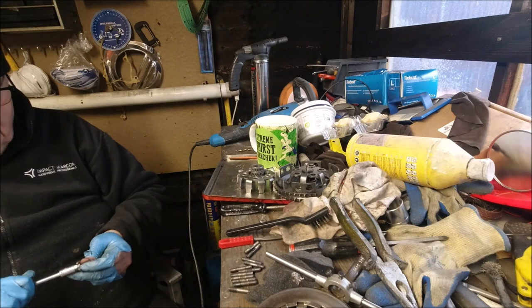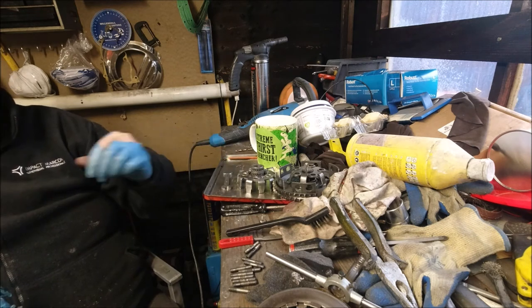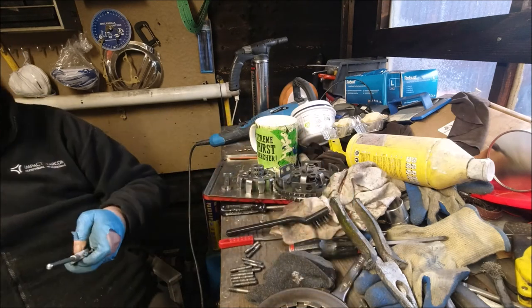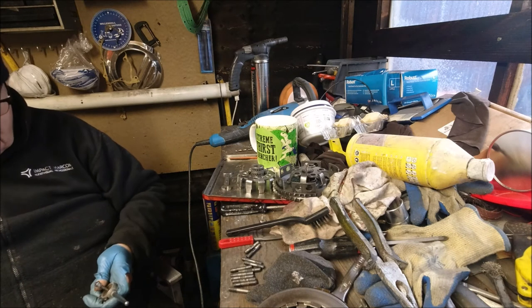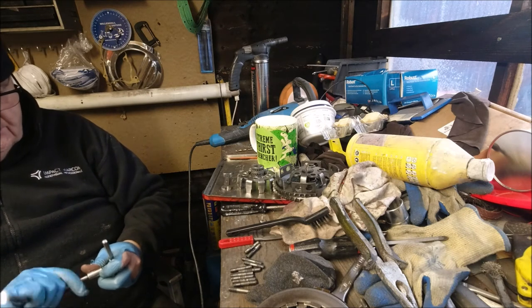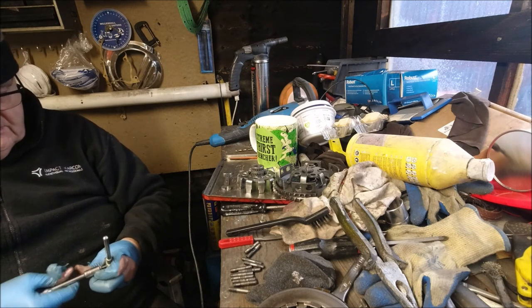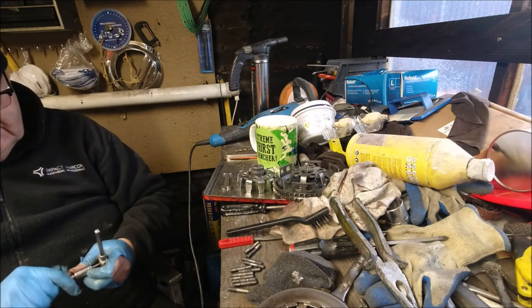So it's just when you tot up what I'm doing here, 50 for that, 25 for that, you're not saving a great deal by keeping an old type clutch in. And as you could see with my GP one, it was not worn out at all, was it? It was just the spring wasn't set right, which I will check in future. Any of them clutches that I do, I'll make sure that they're all seated and level. I just assumed that the write-up I got at the time was they were all filed down and tested prior to being sent out. And I suppose it's the old adage, don't believe anybody, sort it out yourself, which I've had to do.